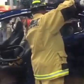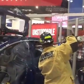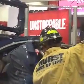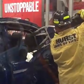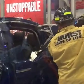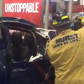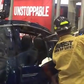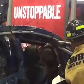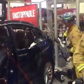The Falcon Wing door is a little bit different. You can see on the other side that they've actually separated the door in two — that's what we're doing here on the driver's side now. The Falcon Wing door opens out and up; it's a two-piece door that's hinged in the middle. What we're trying to do is separate those two pieces of door. We leave the top in place because it's not in our way, and then the bottom, broken free of the top piece, can be removed like a conventional door. We're utilizing the spreaders to break that top door sill away from the lower door sill. This can also be accomplished using a hydraulic cutter or a sawzall with the Falcon Wing door.